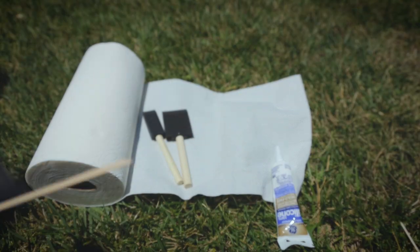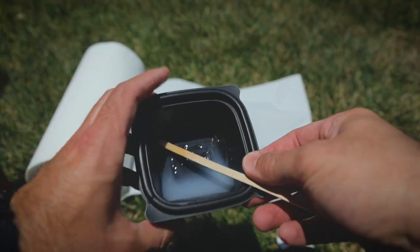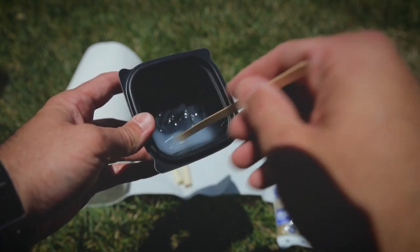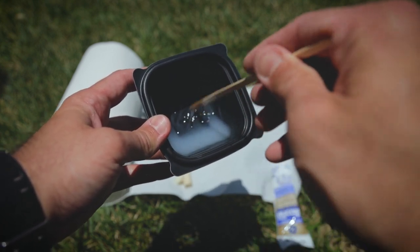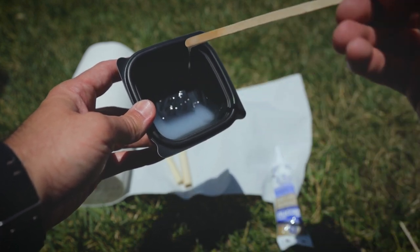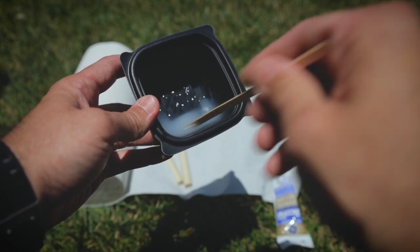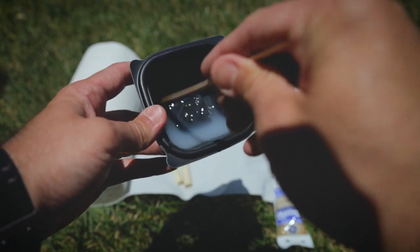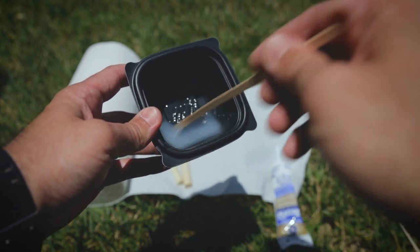After doing some mixing, I stepped away from the camera because as I was mixing it was kind of shooting up and out of my mixing tray. But this is about the consistency you're looking at — the consistency of warm honey. What's really nice about this is that it allows you to actually paint on the seam sealer, and it makes the whole process very, very simple.